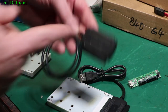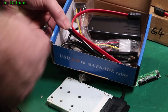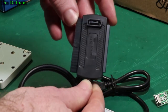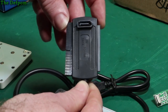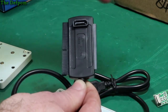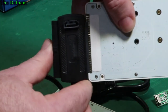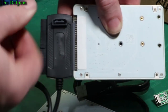However I've come across another problem. I've got two of these. I've got one like a little packet like this - a cheap little packet - and the other one came in a proper box with power supply and stuff for 3.5 inch drives. Now, do you see something with these connectors, the way they sit? You notice it's slightly wonky - this one's sticking out a lot and this one's only sticking out a little bit. If I try to plug this drive in, like I can't actually plug it in. It goes on a pinch just a fraction and that's it - not enough to actually make contact.